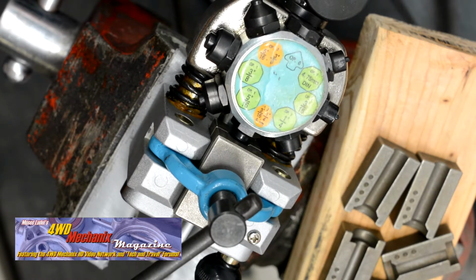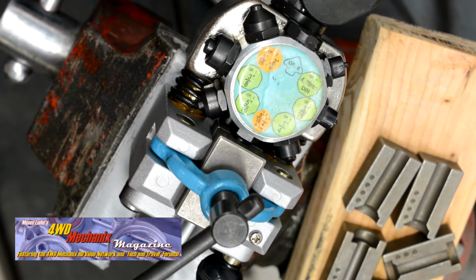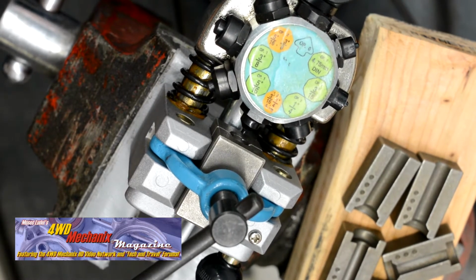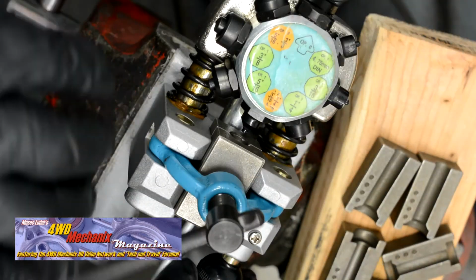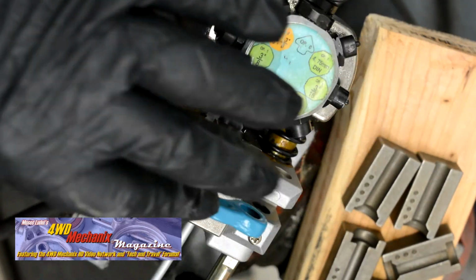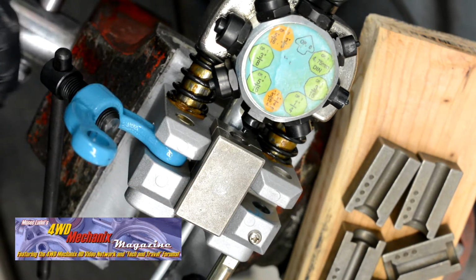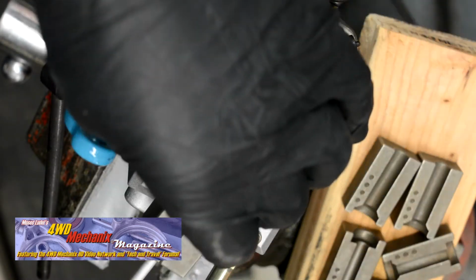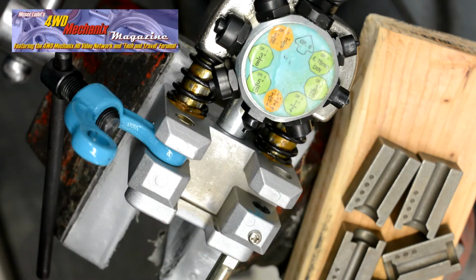The die is 45 degrees inverted. The die punch is a 45-degree match for the inverted 45-degree die. Squeezing the two together forms the double inverted 45-degree flare. You can now remove the die set and tube from the fixture. Tap the die set carefully to relieve tension from the tube.